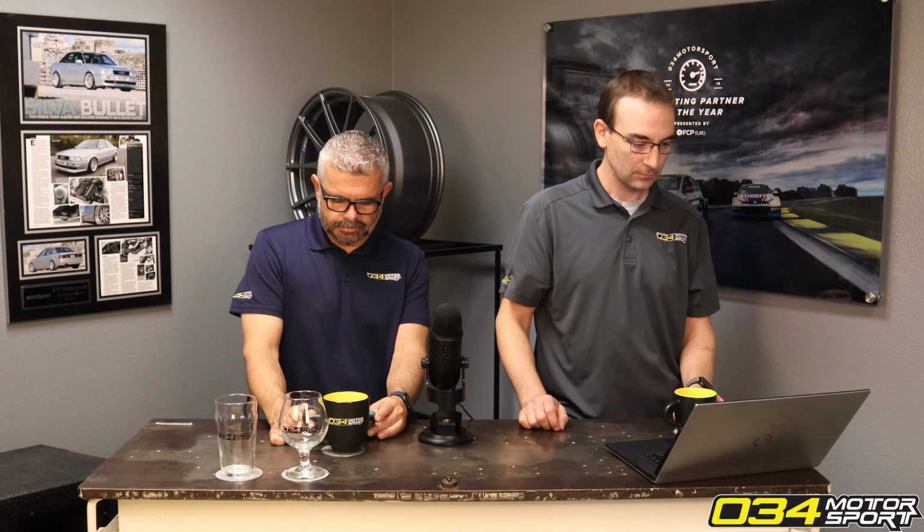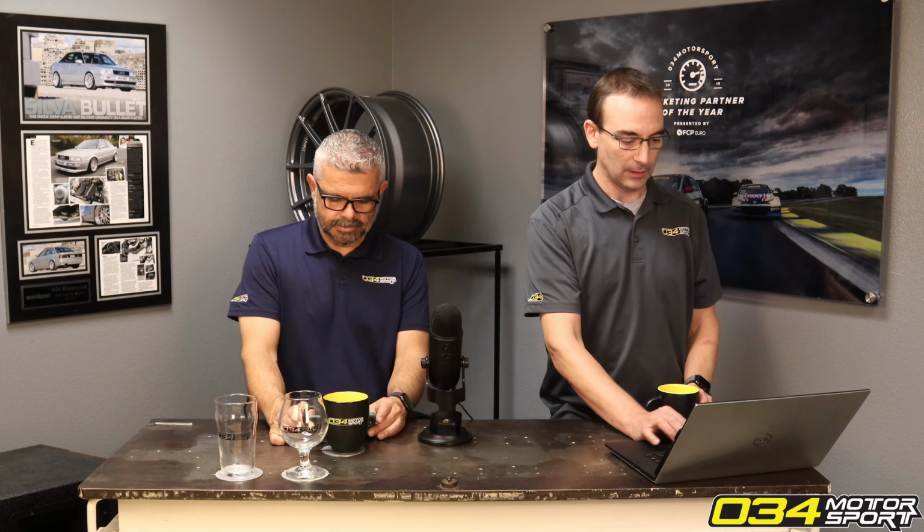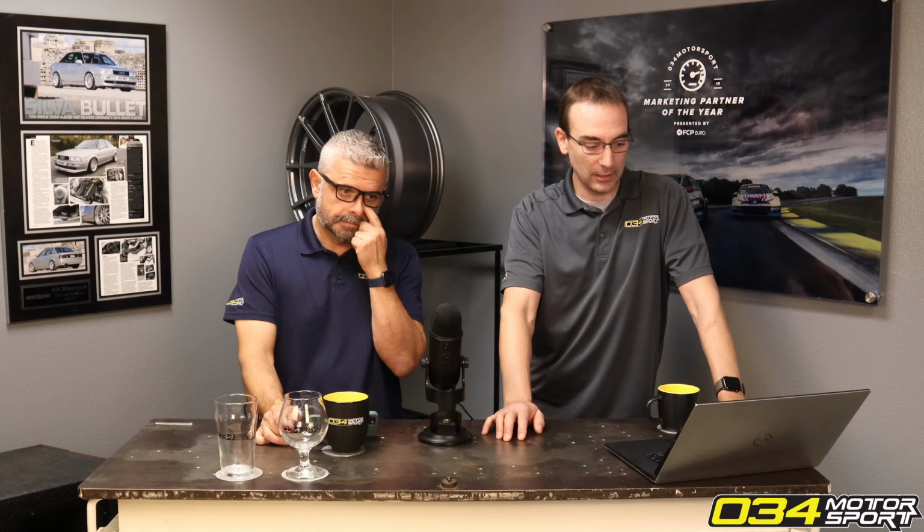Can you tune in benefits from a killer chiller system on a 3.0T B8.5 S5? I mean, they're kind of already tuned in. If it's dropping air temps, you're going to get whatever benefit comes along with it. There's not a lot else to really tune in. The ECU will compensate. You'll see more timing. If anyone tries to sell you a killer chiller file, you're probably getting ripped off.